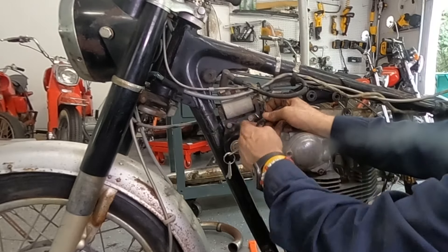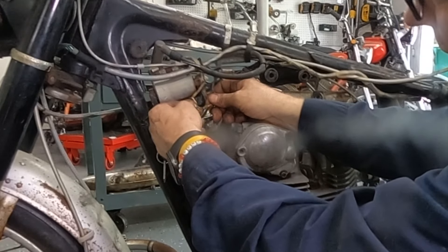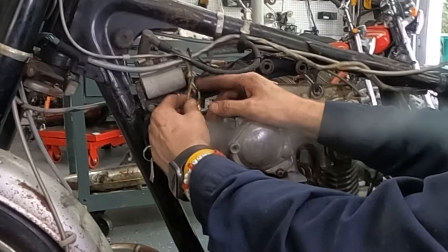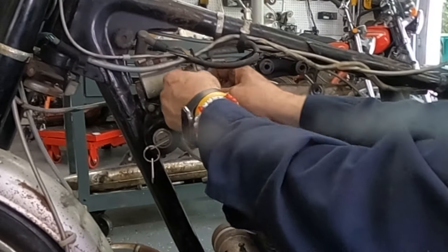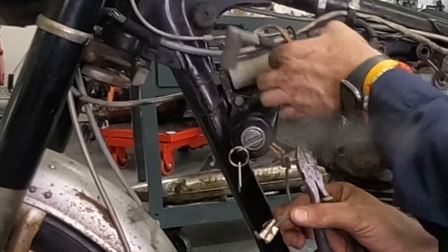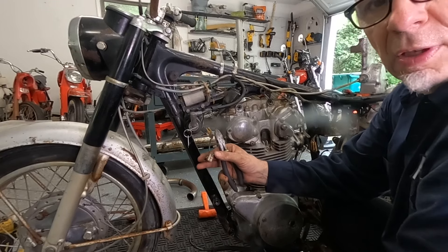This is a mess — all this is going to have to be repaired. Just wrap it in enough duct tape and it can't possibly short out, right? Look at this — it has a wire hanging on both of these. I'm going to snip them right here so I know that these yellow wires go with this one. I'm going to snip these same ones right here so I know that goes with that. That way when I'm rebuilding it I'll have a game plan. The two cut green ones go here, the two cut yellow ones go there — I'll fix those and put it back together.